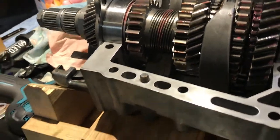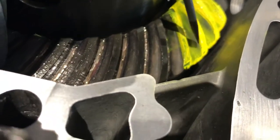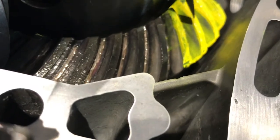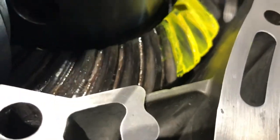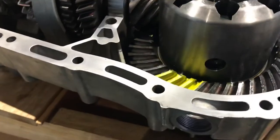So I'm going to shim out at the back here at the bearing face just a bit more — I've got a selection of shims I can use. The reverse side, or the coast side, isn't too bad actually, but it's kind of the opposite: it's starting down at the outside and coming in. So I'm just going to make a slight adjustment and then run it again and see what we get.